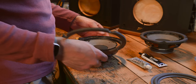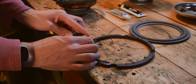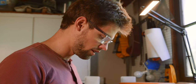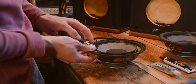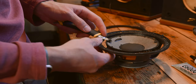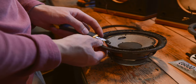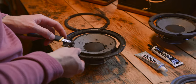After much patience, we got that gasket off, and I did rip up a little bit of the paper. That's not the end of the world if you rip up a little bit of it. And then this glue that's on the bottom, ideally you get as much of it off as you can, but it's not going to be the end of the world if there's a little bit on here still. When it comes to actually cleaning the old foam and the glue off of the cone, what I like to do is push my finger behind the cone, and then put the knife over the top so that you're kind of bracing the cone. Then you can just kind of work the knife over it. You don't want to apply very much pressure because you're just trying to cut off that top layer of foam, but you just want to brace the cone a little bit so that it's not pushing it too much. It's not going to be the end of the world if it moves around a little.